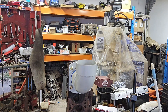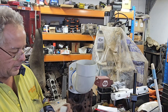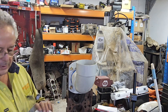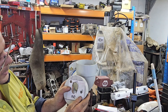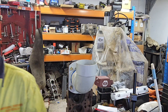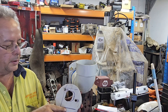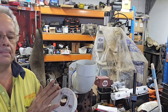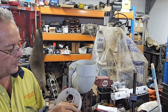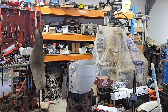The exhaust adapter — the exhaust template — notice I marked them 'head face' and 'out', and the reason being is that because this one is going up against the head face, I need to know which way my gas is going to go when I mark it out to cut it. Also, be careful on some of these — this one had it — they have some stuff sticking up off the head face, and you'll have to give that a rub with a grinder just to delete it. There was one deleted from here, one from here, and one from over there, so that it gets a flat face. I've used 100mm wide gaffer tape to provide a gasket-type surface.